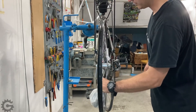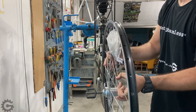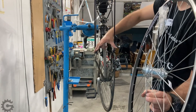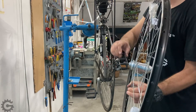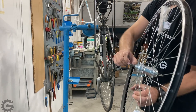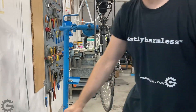What can we do to make this work? We could add a few more nuts on both ends to make it wider. But even so — this is a 130 millimeter wide dropout, and some multispeed bikes, especially mountain and trekking bikes, have 135 millimeters — the bolt will not protrude enough to screw on with full thread engagement. To be secure you need full engagement, so we would have to alter this distance.